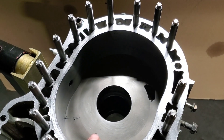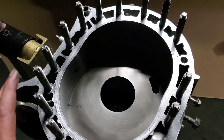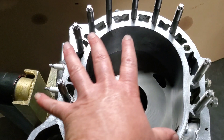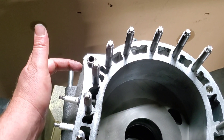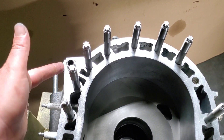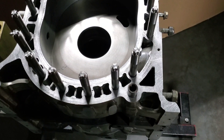This can be run up into the 30–40 PSI plus pound of boost range and still have reliability, because you're eliminating some of the block's ability to twist, which then applies load to these original dowel pin areas. A lot of people will go with solid dowel pins — I've seen people apply oil pan braces, this motor had that as well — it didn't fix its problem.